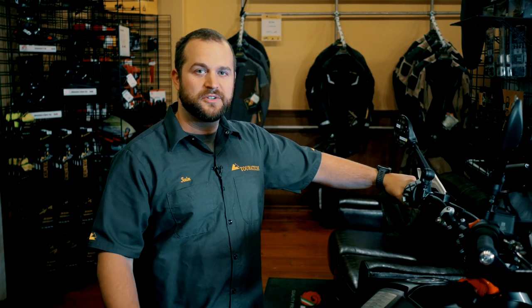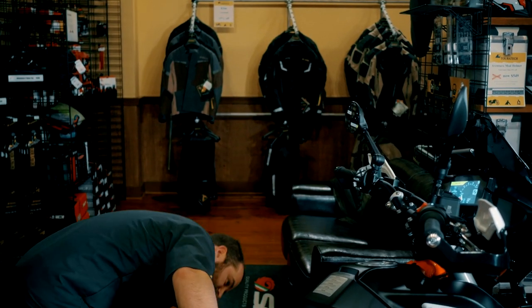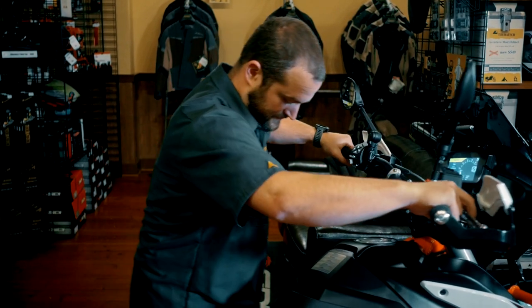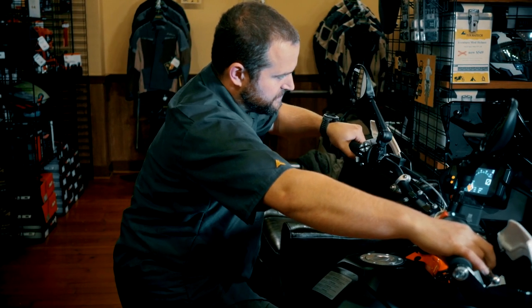The bike is totally reassembled and everything is ready to go. The last thing is to check for any fuel leaks and make sure the clutch disengages all the way. To do that, have the bike running, get the kickstand up, hold the clutch in, click it into gear, and then make sure you can find neutral again with the engine running and the clutch lever pulled all the way in to the bar. If you want to learn more about parts for this motorcycle, visit touratech-usa.com and subscribe to our YouTube channel and click the notification bell to know when we release new videos. Thanks and have a good ride.